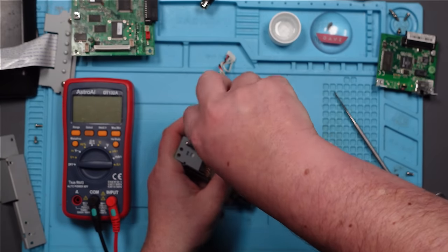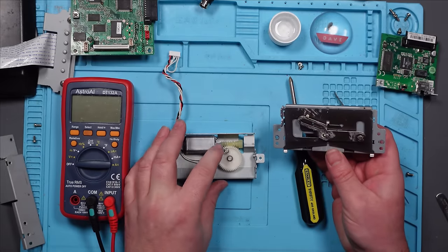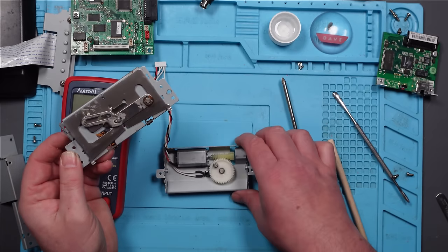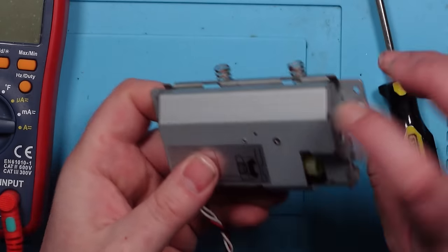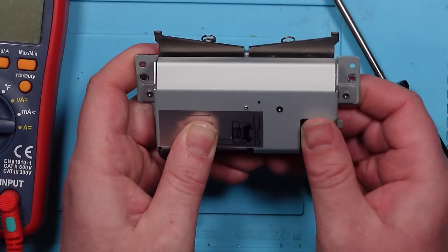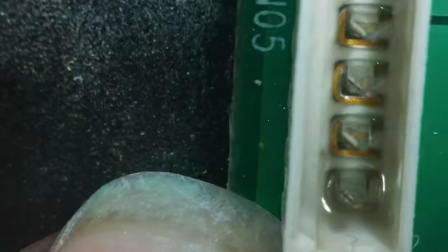I could also swap out the cutting mechanism for the working one to confirm. But let's open it up first. We've got a motor in there - that looks fine, assuming the motor is actually turning. It's all nicely greased up. I'm not sure the problem is there unless the motor's gone - I can't see any corrosion. If I turn this gear you can see the blade coming out, and going back the other way it retracts. So I'm not convinced there's a problem with the physical cutter mechanism.